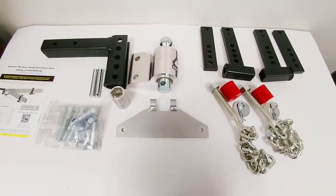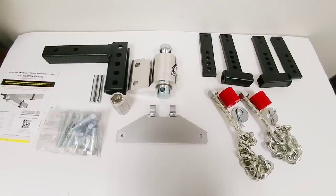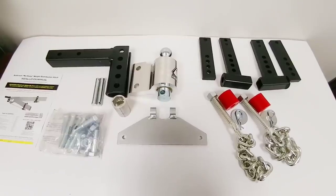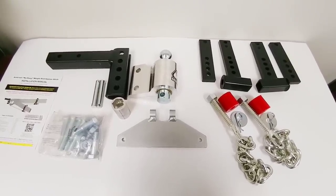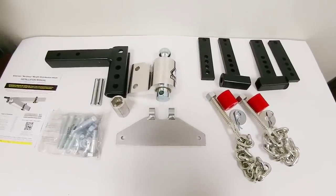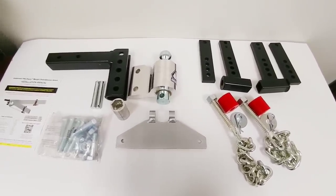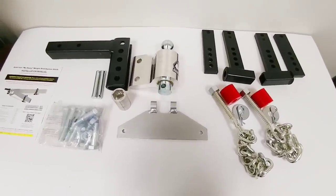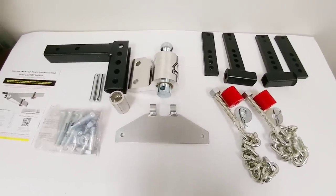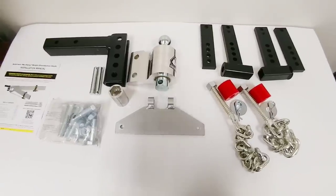I have everything laid out and unpackaged now. As far as weight distribution systems go, this is a really cool package. First of all it weighs less — the entire system probably weighs about half the weight of a traditional weight distribution system, mainly because you don't have the long metal rods or bars used in traditional weight distribution. This system uses friction instead. It's a different method but in my opinion a better solution simply because it has fewer components that could fail, it provides sway control all the time, and you don't have to worry about removing friction pieces when backing up or every component having to line up perfectly.